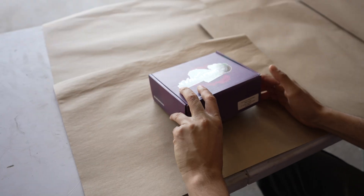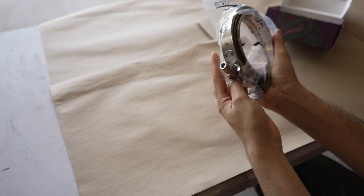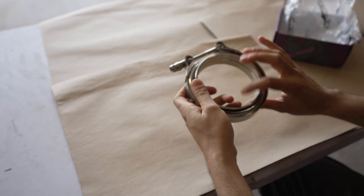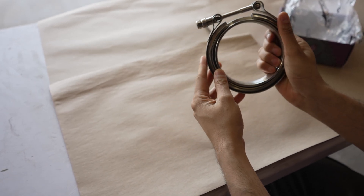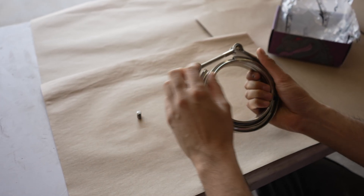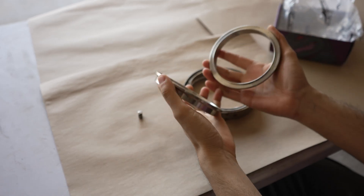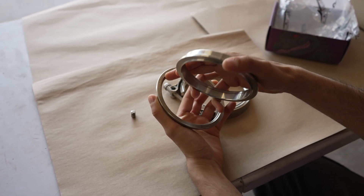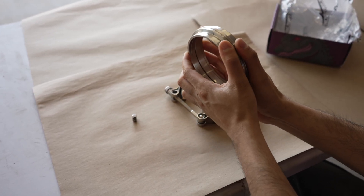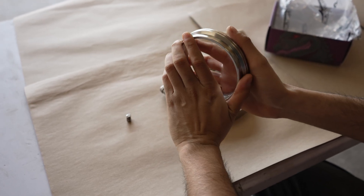I'm just gonna show you a quick unboxing of these and show you how they come apart. We already took this one out of the package earlier. So you've got the V-Band clamp on the outside with the flanges in the center, and it is literally one nut to undo them. The V-Bands come out, the clamp comes out. You can see one's a male and one's a female on both flanges and they go together and literally just align. You don't need a gasket or anything — they bolt straight together.